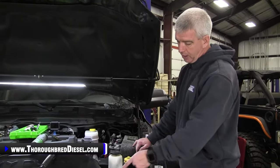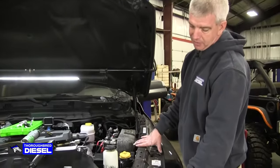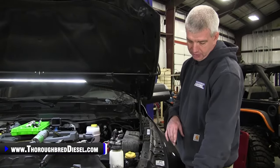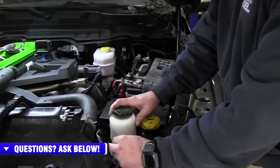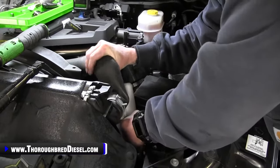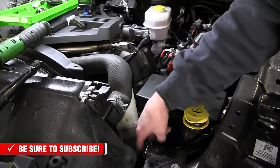We go ahead and run a rubber line over to the drain — the drain's got a nipple on the bottom of it and you can hook a rubber line onto it and let it drain out through the bumper. On these 2013 to 2018 trucks, you have your radiator and your intercooler is angled at the bottom of that. This gives us access to get a hose in to our radiator drain. On the driver's side you have your power steering reservoir — it's a 13 metric bolt that holds it on. Just remove the bolt, move the reservoir underneath the upper radiator hose to get it out of the way to reach the radiator drain on the driver's side. Look straight down — you can't miss it.